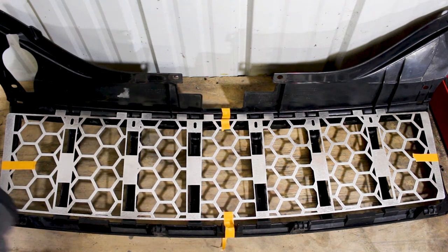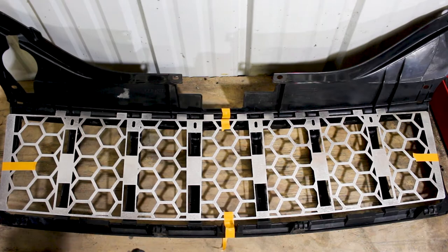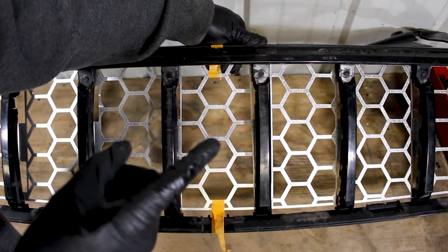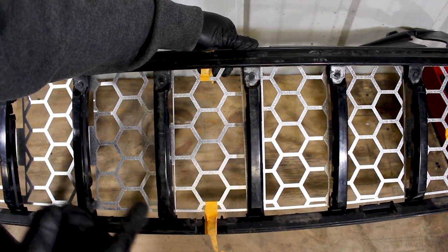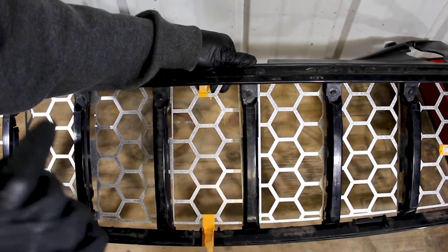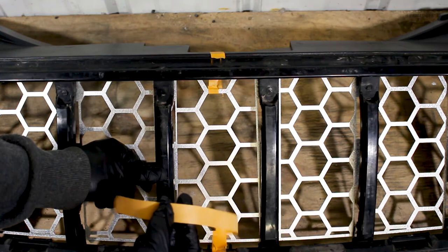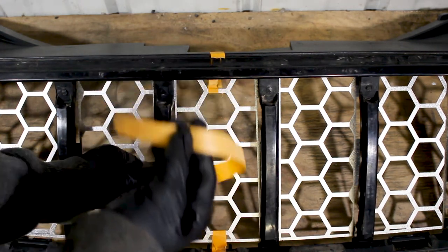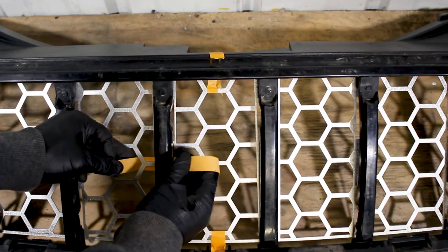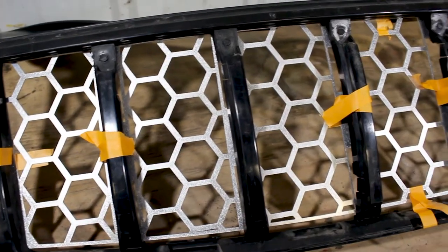That vertical adjustment is a really great engineered feature. I have tape marking the center lines and marking the sides. You can be very precise here and potentially measure the halfway point using a caliper if that's of interest to you. I've flipped it over again, everything looks good and even from side to side, the center clip looks even with the center of the grille insert. Measure as many times before you drill - I'm going to mark where I'm going to drill the holes, remove the grille insert, and use a quarter-inch drill bit to drill where I'll put the mounting hardware.